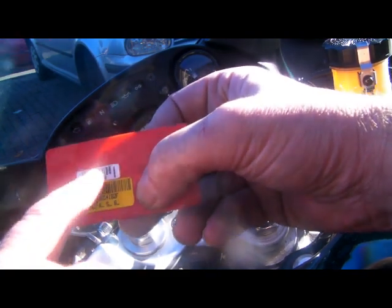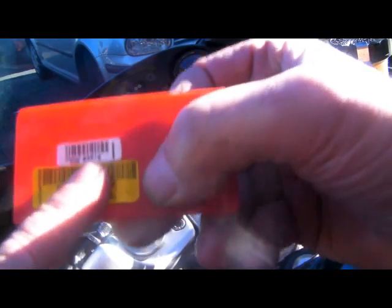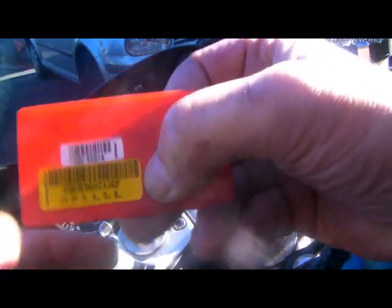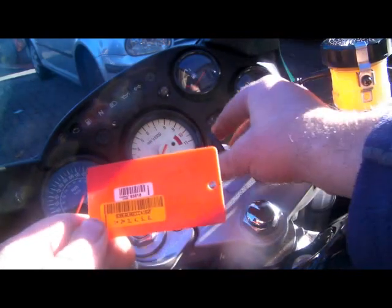The M357TV2 - that's the standard. The DEFCOM-T, if it's not passive arming, you'll have to buy a new alarm. You can't code a new alarm in from scratch because you can't get into program mode. To get into program mode, we use this number here, which is 63518, and you do that by entering that code using the ignition key.